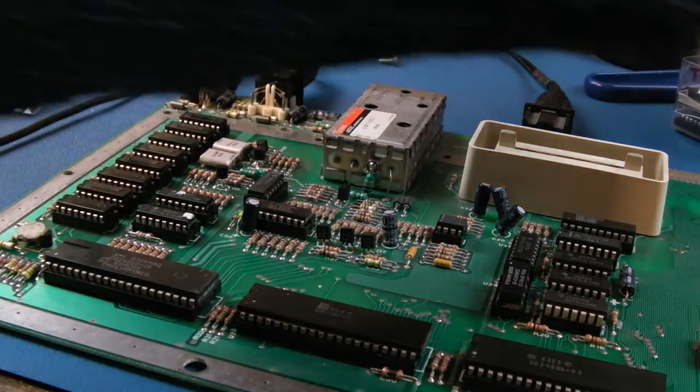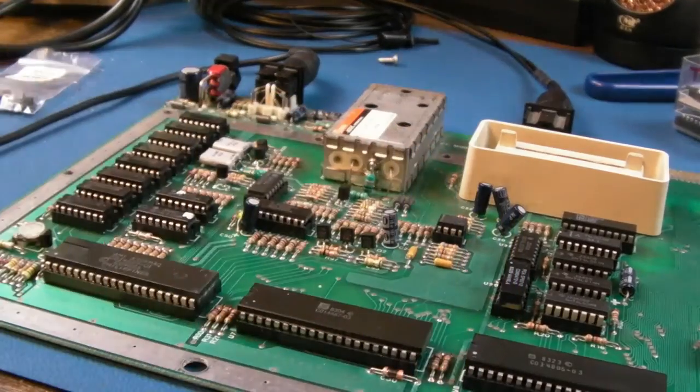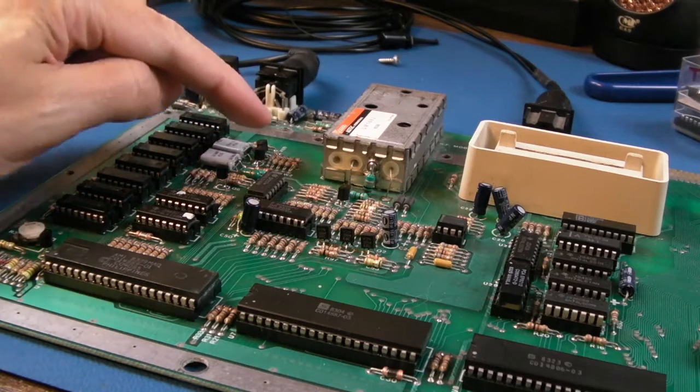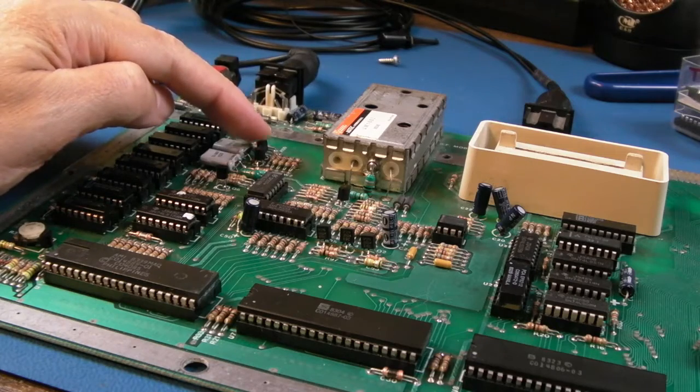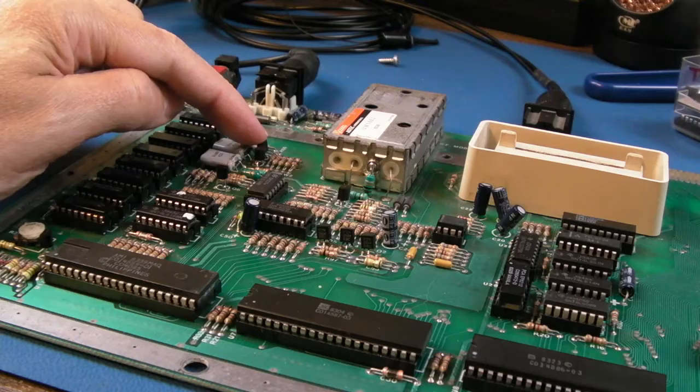So I tested those in the Atlas here, and I was looking at the gain in particular. The original transistors were on there, I'll show you the readings of those in a minute, but they were significantly less. The ones I was fitting were over 300, in terms of the current gain, I think it was. And then the original ones were like 218-ish, 217-ish, so I'm like, well, there's a big difference.